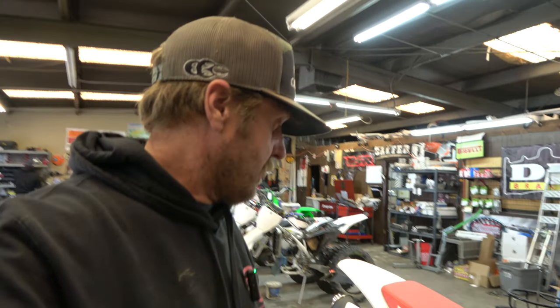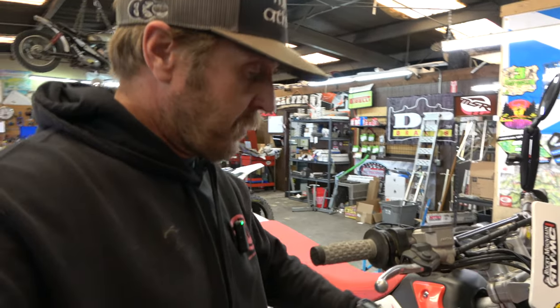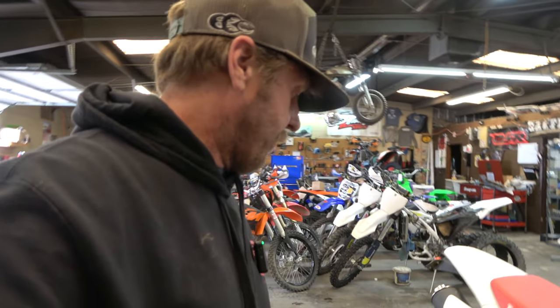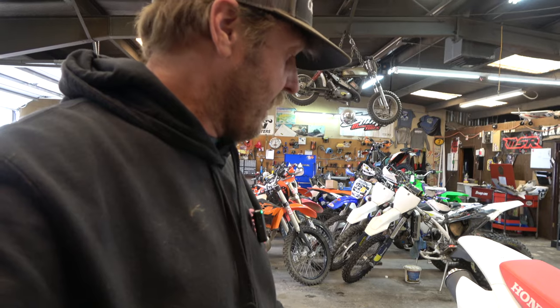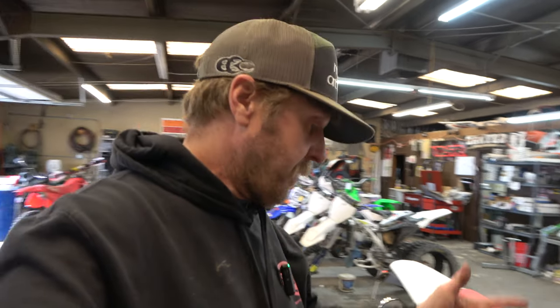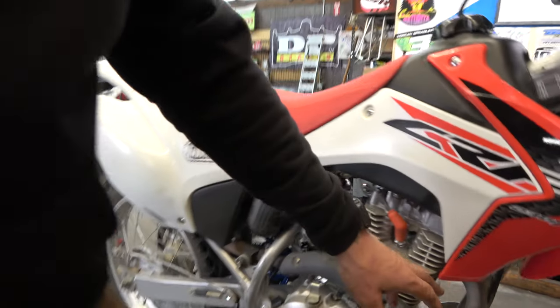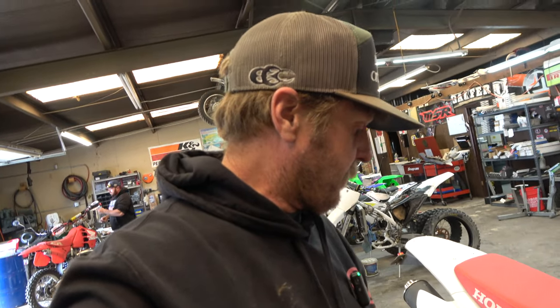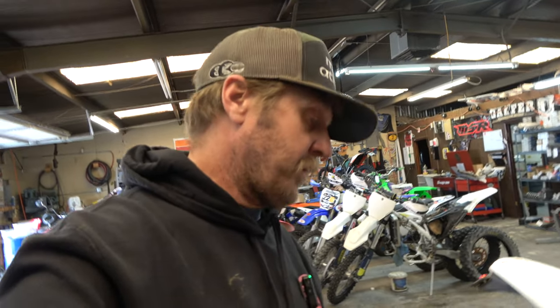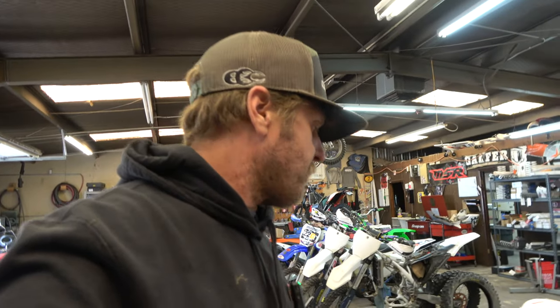All right, guys, so I went over the whole bike, got all the pinch bolts on the triple clamps, wheel axle nuts, just pretty much everything, motor mounts. Actually found the exhaust mounts a little bit loose, where the header goes into the cylinder. Not really loose, but a tiny bit. I was able to tighten them up. Hit every spoke and tightened those up. They're a little bit loose, not bad. You saw I hit the sprocket bolts.